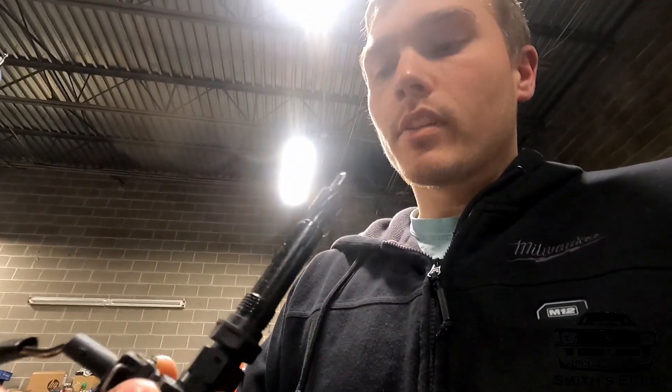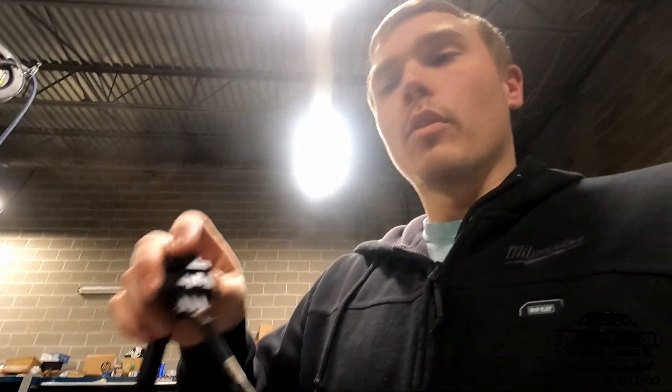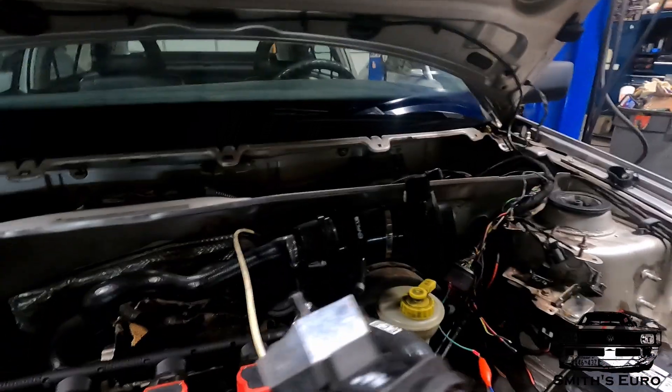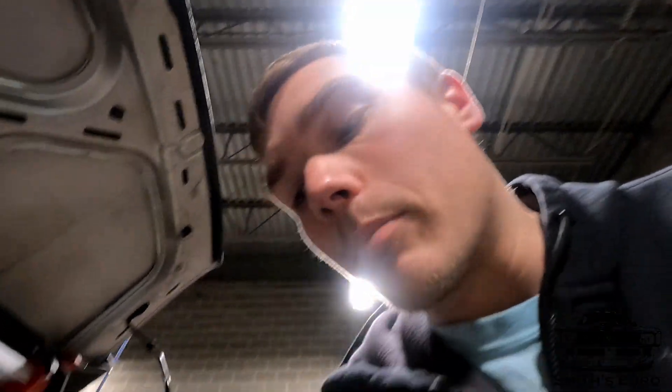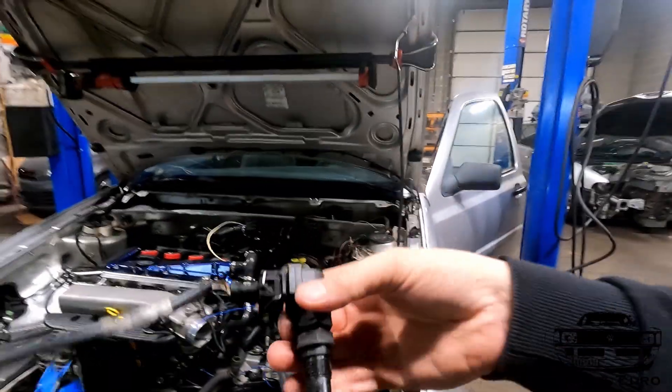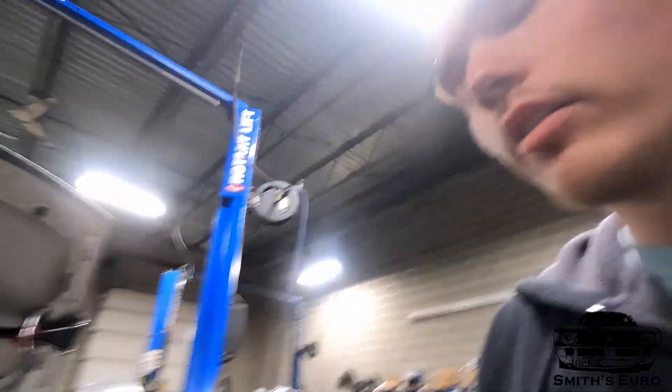I keep many things, so this is a plug off of any Mark 3, B3, B4, Corrado - many many cars. This is just a rectangle pin, whereas on a Mark 4 mostly all the connectors are now D-shaped. What I mean by D-shaped - here's a great example - here's the MAP sensor, you see it's flat on one side, curved on the other side - D-shaped, easy enough. Square rectangle, whatever you want to call this - there's a bunch of them on a Mark 3 with these horrible, never-disconnect metal clips that you just gotta yank off. I'll make a little sub-harness for it since I'm already way too far into this thing and not reopening the harness. Test tape it, run it over, connect it where it needs to connect - whenever you pull the trans this will follow the engine harness but will not be part of it.